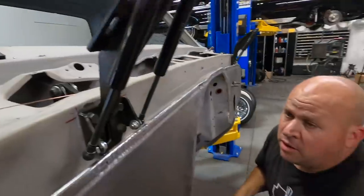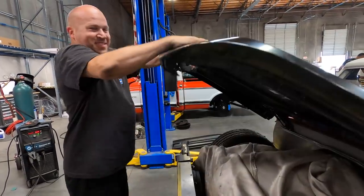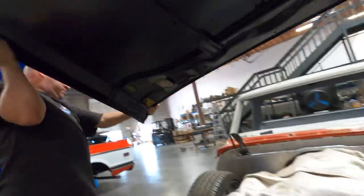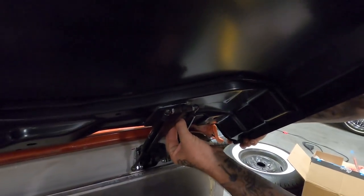On this truck we installed our Switch Suspension brand hood hinges — they're for your '60s and early '70s trucks where, when you're going to lay them out on a big wheel, the fender well has to move. Anyone who's done that knows the hood hinge is then in the way. This is a product we sell here that allows you to move the hood hinges inboard and use the factory hood. It can actually be done to a painted truck with minimal damage — the only thing you'd have to do is repaint the underside of the hood where you weld on the plates. It's a very nice product and easy to put in if you can follow basic instructions.